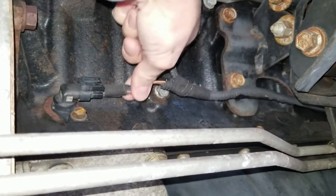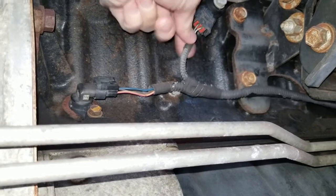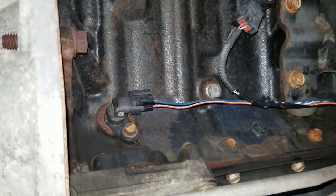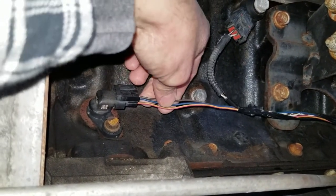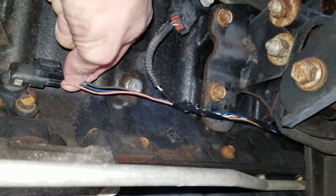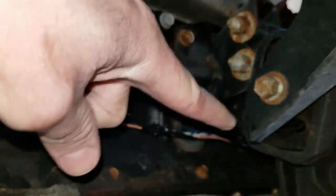Of course, it never works when the camera's on. Oh, there we go. Maybe the issue's here at the connector — it seemed to die when I was here. I'll try to restart and see if I can recreate that. Well, as luck would have it, I can't even get the engine to restart now. Just with me fiddling with the wires, I've permanently caused the issue to remain. It seemed like when I jiggled here by the connector it shut off, but when I first did this the other day I seemed to be causing the engine to shut off when I was pulling up along the harness. So that leads me to believe the problem is up there by the oil filter.